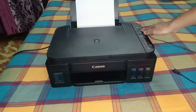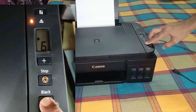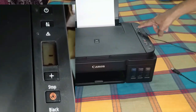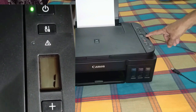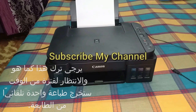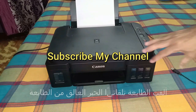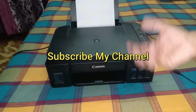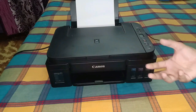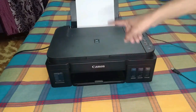Once the ink is refilled, make sure your printer is started. Then find the black button on your printer and press it for a long time. You will see the green light displaying on your printer's screen. Leave the printer as it is and wait for a while — a printout will automatically come out, as the printer automatically ejects the stuck ink.